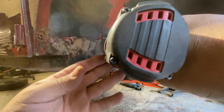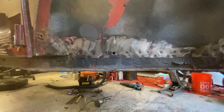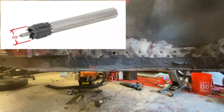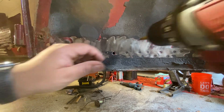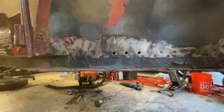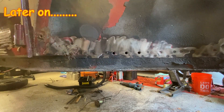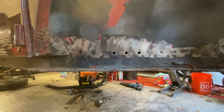Use a bit about 11/32nds to 3/8 — your average spot weld diameter is about 3/8 of an inch, so if you go in between that size on your bit it should be fine. All these holes you want to spot weld again for the new heater channel — that's the best way to do it instead of cutting out good metal. This is the best approach I've found that's worked for me.